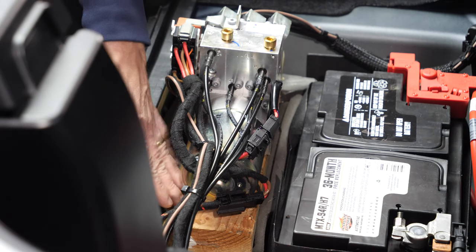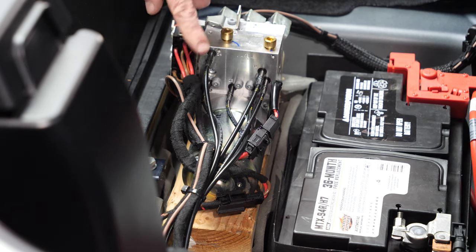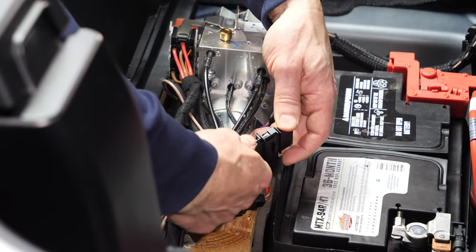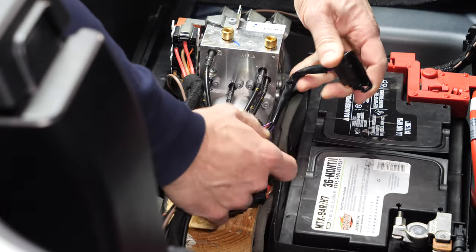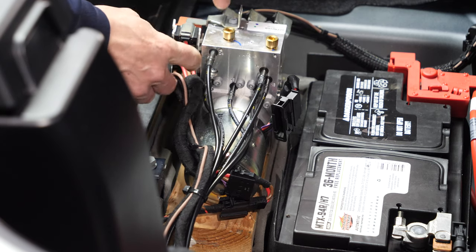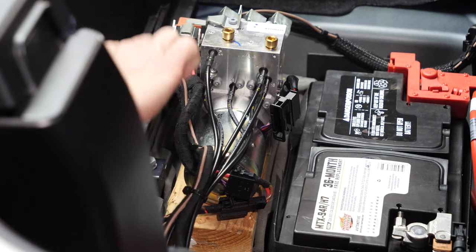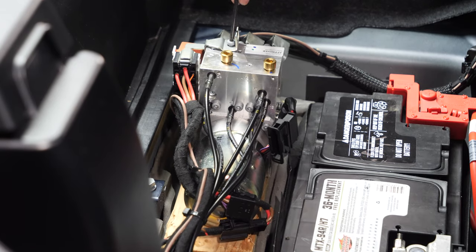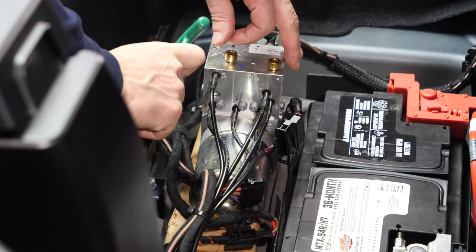I've made my job a little bit easier by putting the pump on top of a 2x4 so it's not all the way down in a hole, making it easier to see all the little bolts and connections. Let's do the simple stuff first and remove the hoses. To remove the harness from the pump motor, you just push down a little tab here and pull the connector out. We also want to free up this relay bracket — just unscrew it with our Torx T25 and push it aside into a convenient space.